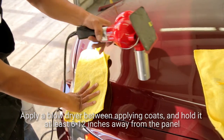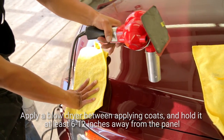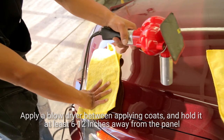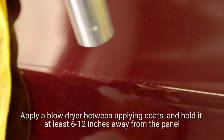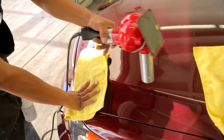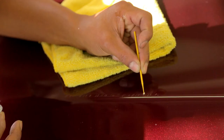Once you're done touching it up, take a blow dryer and heat up the area with the scratch on it so it'll allow the paint to dry quicker. You don't need to do that — if you want to be really patient, you can touch it up, let it dry for one day, come back and touch it up the next day. But if you want to get it done quicker, you can use a blow dryer. Don't get it too close to the panel — I'd probably say about 6 to 12 inches away. Otherwise, you can actually make the paint start to bubble. Put another coat on it, let it heat up with the hair dryer, and then follow that up with the clear coat.